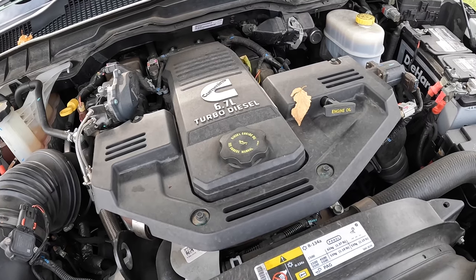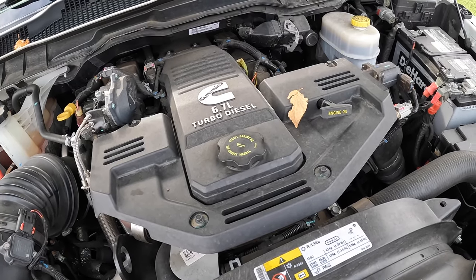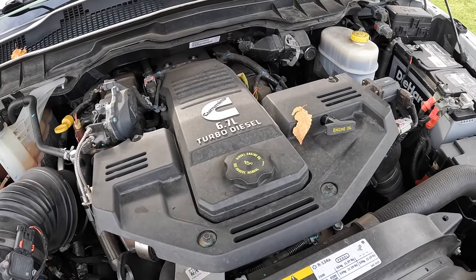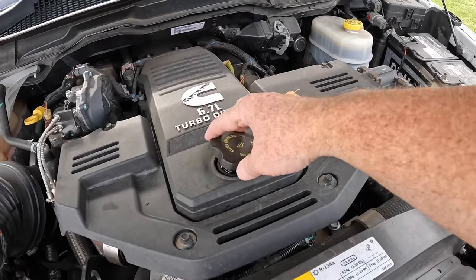After making sure you place the oil plug and screw it back in, make sure it's tight. And for the oil filter, make sure it's hand tight and then about a quarter turn past that with a tool. We already loosened the oil filter cap to let the oil drain a little quicker.